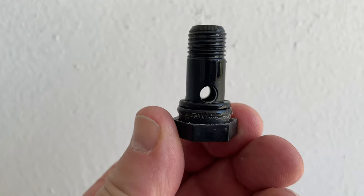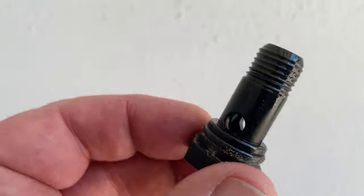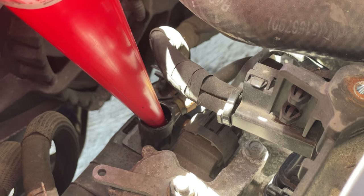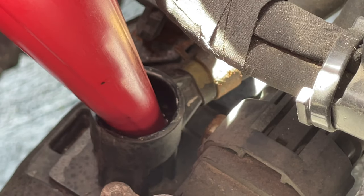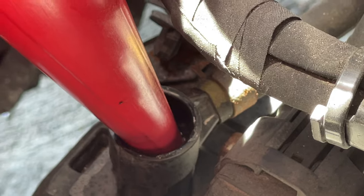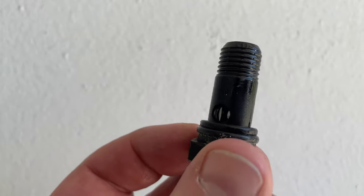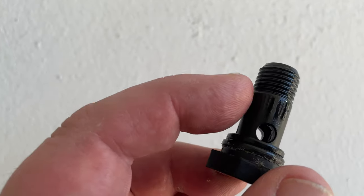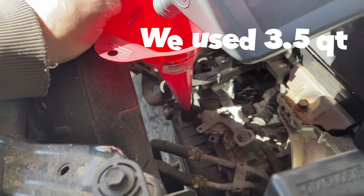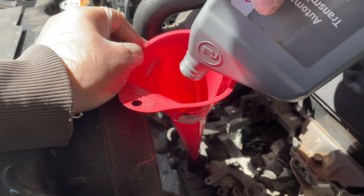Here is a plastic piece — make sure that this rubber ring is okay, that there is no rip or anything in there, and that the whole screw is in one piece. It's hollow in the middle. Look down there — that's the fill hole. You're very slow getting it in there. When you screw this back in, since it's hollow, you have to be very careful — do not over-tighten it. The change amount is like three and a half to four — that's how much we need.